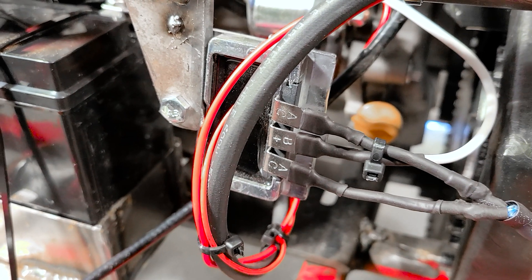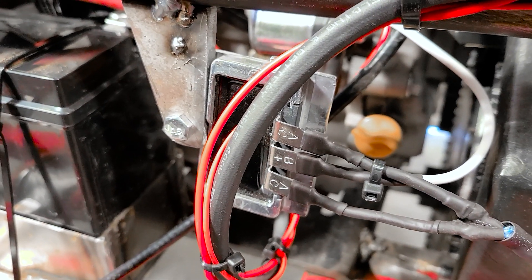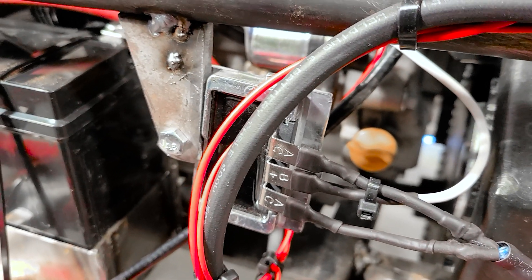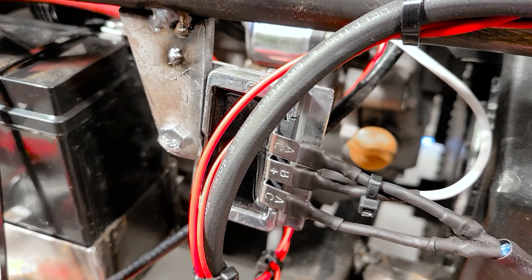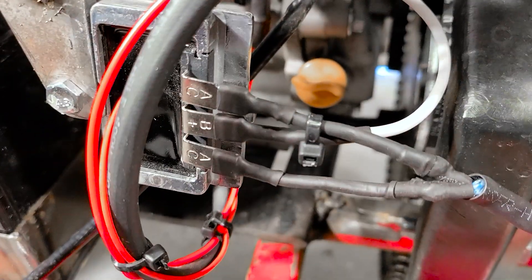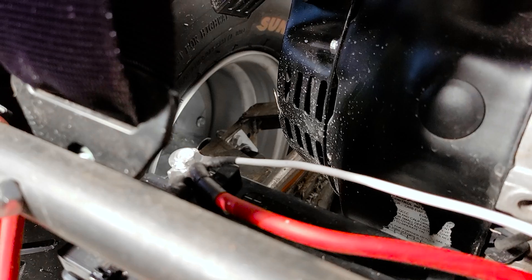That's going to put it through basically a big diode, and then it's going to come out the B+ terminal. Your B+ terminal brings your nice smooth voltage over to your battery. You can see I've got this white wire here that runs over to the positive tab on our battery.